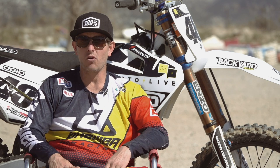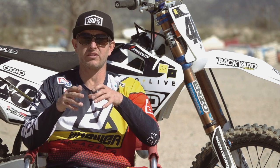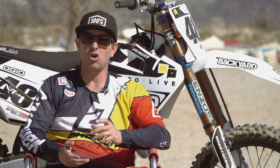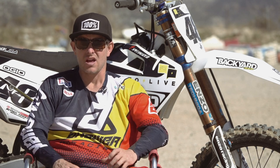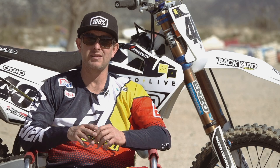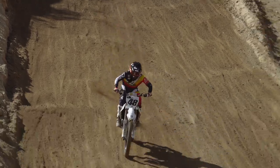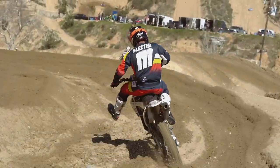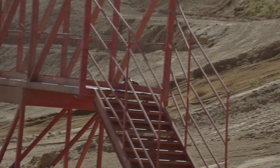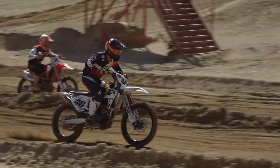We've got a couple rides on it now and we are extremely happy with it. What we found right away is that the consistency of the fork down the hills into the hard braking bumps was better. We had more contact patch feeling on the tire without losing the comfort. The AER fork tends to flex on slapdowns, so on those harsh landings you get a vibration in your hands. With these Technical Touch lugs, using this small diameter axle that's production on the bike, you get confidence on the hard landings and confidence in those hard pack turns — allowing that axle to flex and getting that contact patch to be more confident on the tires.